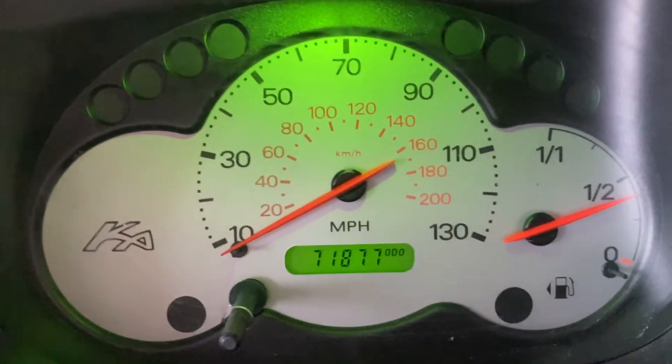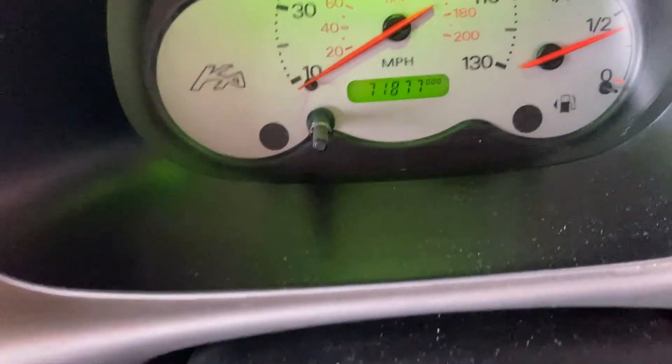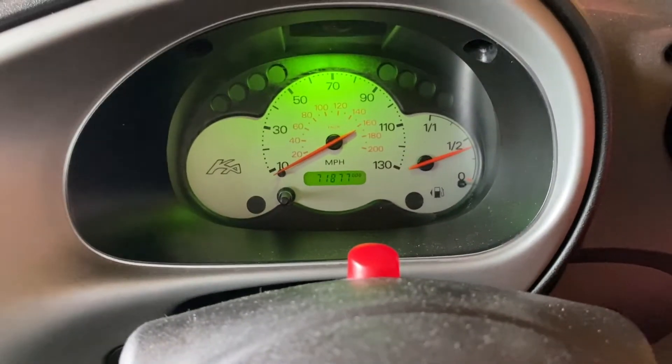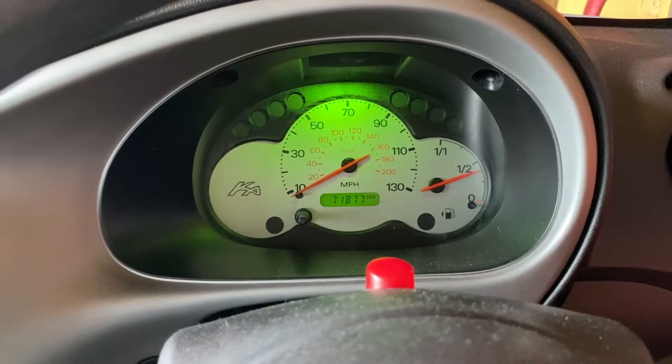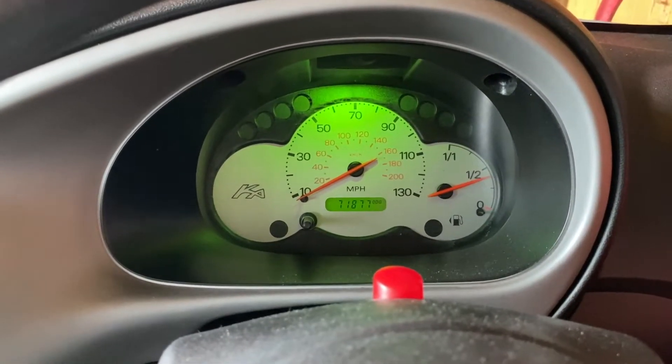If it hiccups, if it stutters and stammers, that's because there's not enough fuel in the filter and you'll just prime it again. As long as we've got a nice steady smooth idle here. And there's the mileage at which all this service work has been done — 71,877. That's had the oil, the filter, spark plugs, air filter, and the fuel filter all at that same mileage.